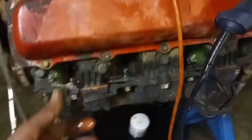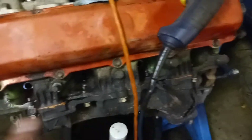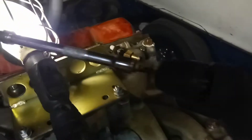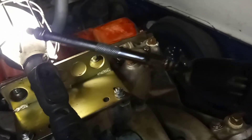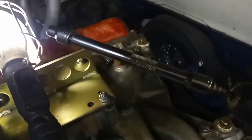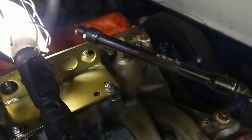If it's a good fresh motor, just put motor oil in it. Pull all your plugs and give each a good squirt. Get yourself an adapter for your drill like this, or weld one up — it's a 5/16ths for the oil pump drive off the distributor, same as a Ford. Pop her down in there.